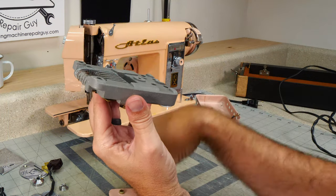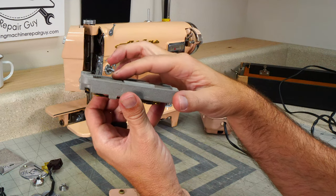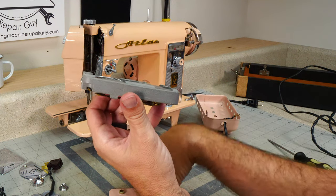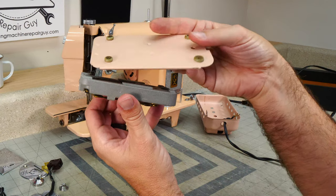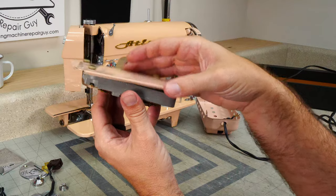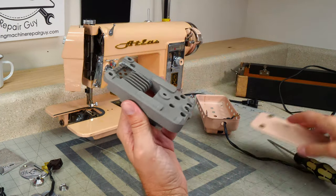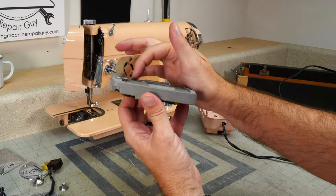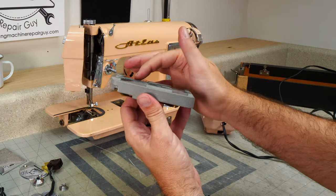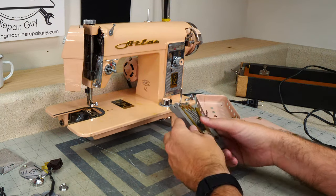That one spring is higher than all the others, all the other resistors. So that spring could touch this plate, and if you use this thing with your hands or with your feet, you're barefoot, you could get shocked, and that's not safe because that is up above the rest. It's not recessed all the way down in this ceramic material.